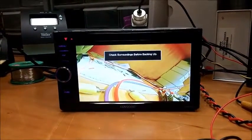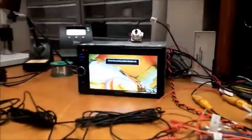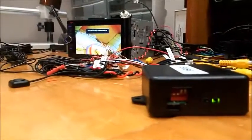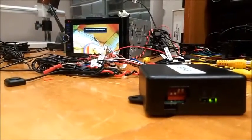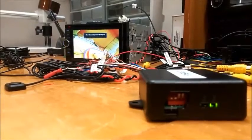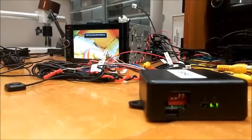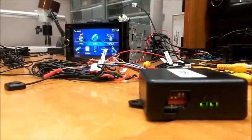There's our front camera, and the front camera is on a timer as well if you want it to be. With DIP switch 4 up, it will stay active for 12 seconds. So basically, if you put the front camera trigger on a momentary, you touch it once, it stays active for 12 seconds while you're rolling into a parking spot. It's great to see the curb, and then it goes away automatically.